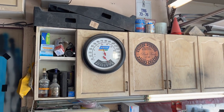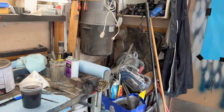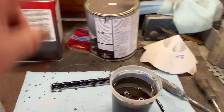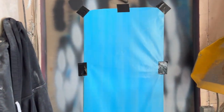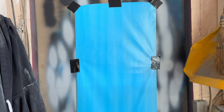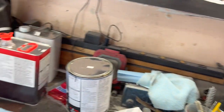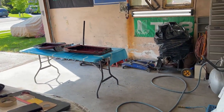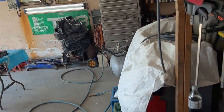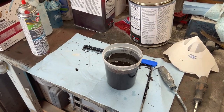It's just coming up to about 9:30 and we're getting pretty close to 70°F — I think I can shoot anything over 65 — so we're going to go ahead. We've got our epoxy mixed up one-to-one and the paint gun standing by. We've got a test paper ready because I haven't painted in a while and I want to make sure my pattern's correct. I'll do a couple of spray-outs to make sure we're good to go. Panels are all clean and ready to go on the table. I'll blow them off with the air gun, tack rag them, and get ready to shoot.